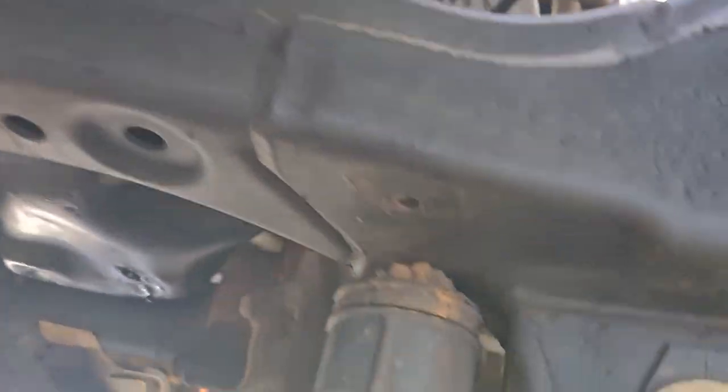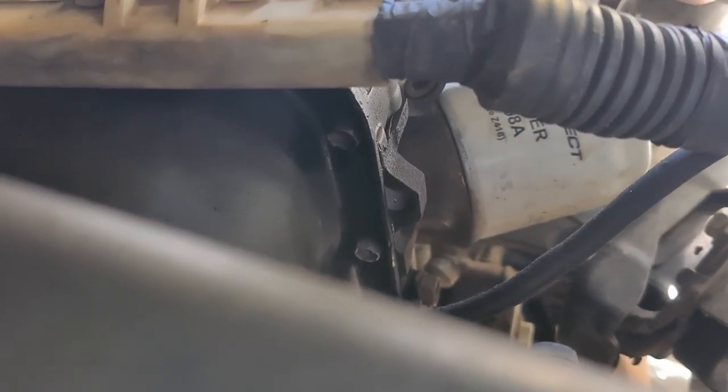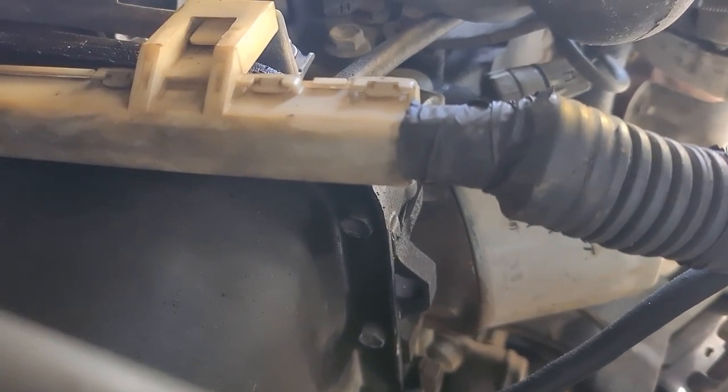You can get them from SuperCheap Auto. The oil filter is in a bit of a pain-in-the-ass position — not because of the angle of reach, I can get a filter removal tool around it pretty easily. The problem is the oil is going to spill out over the side of the engine block, hence the big area of cardboard so I don't have to worry about it getting on my driveway. I'll get that off, lube up the seal on the new one, and then throw that on.